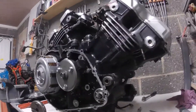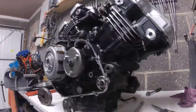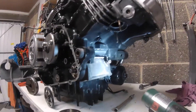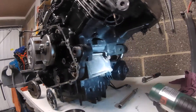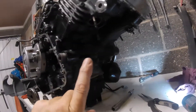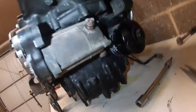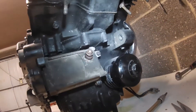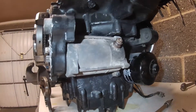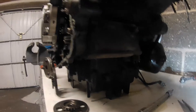Having said that, they're becoming a little bit few and far between now. So an upgrade — that's the word — is a VFR 750 starter motor. Honda produced the VFR 750 in millions, so there are loads of starters available. As you can see it's been on a while now. It uses identical mounting points — it is basically a case of removing your VF starter and fitting a VFR starter motor, in terms of physical mounting.